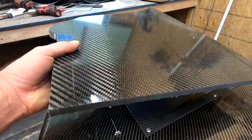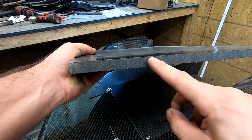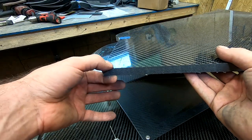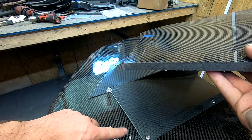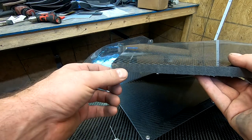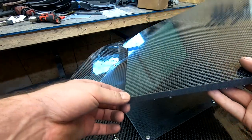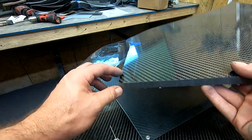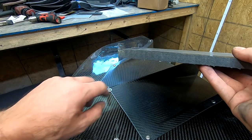Here's the off-cut of our splitter so you can see the carbon top, carbon bottom, and what's called a closed cell foam — a dense structural foam where the cells are closed, so it won't ever absorb water. That's why we can get away with just cutting right into it. If you had a Nomex honeycomb or something similar, you'd want to be extra careful and may need to seal the cut edges. With wood you'd also want to seal any cut edges, but with our carbon splitters you can cut in and you'll be fine.